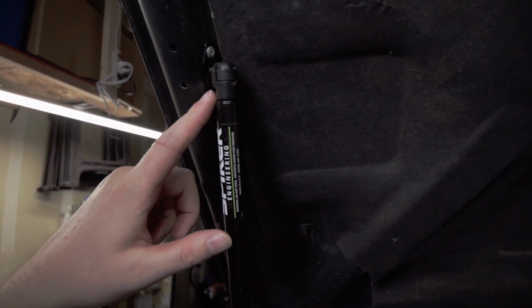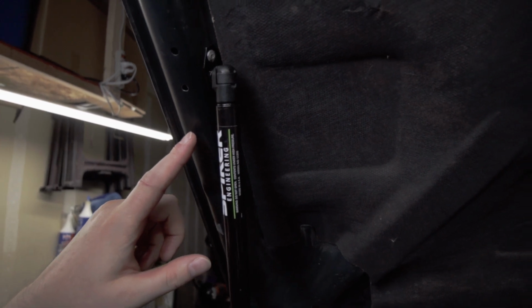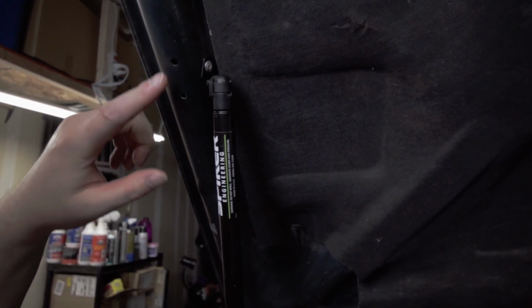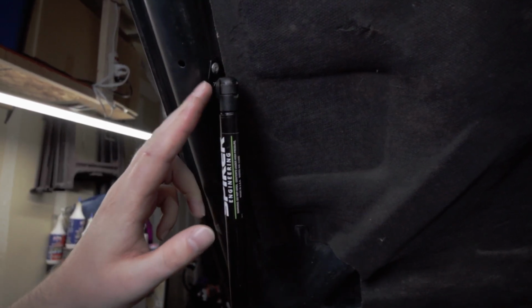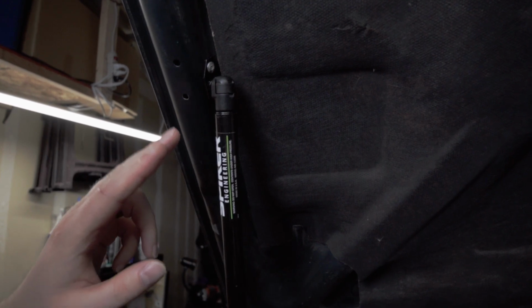If I show you here, you're going to see that I've got them placed now inboard of this support rib on the hood. And you can see here right now what I'm about to do is put these on this OEM hole, and here's the hole that I drilled. As you can see, I drilled those rivets out and then placed that bracket more inboard. So this allows the bracket to clear the inner fender, whereas if you have it on this flat spot here, it's not going to clear the inner fender of your vehicle. So make sure you do that, and don't follow what I'm about to do here, but let's get back to the video and you can watch me screw this one up.